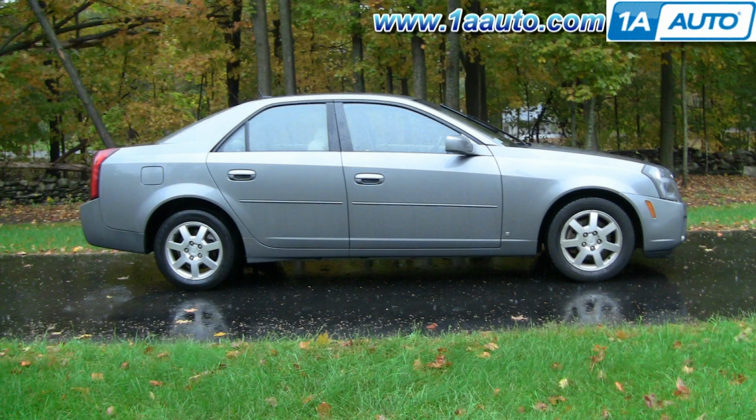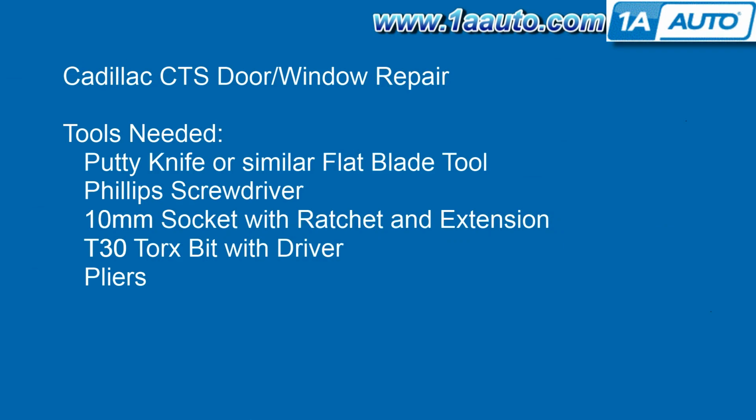In this video, we're going to show you how to replace the rear power window regulator in this Cadillac CTS. This is an 06. This procedure is the same for any 03 to 07. And we do the driver's side in this video, but the passenger side is the same procedure. Tools you'll need are a putty knife or similar flat blade tool, a Phillips screwdriver, a 10mm socket with a ratchet extension, a T30 Torx bit with driver to change the motor onto the new regulator, and a pair of pliers.